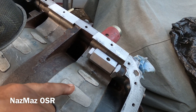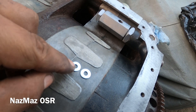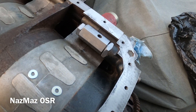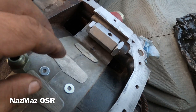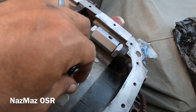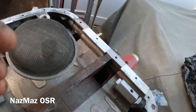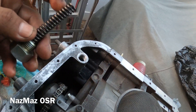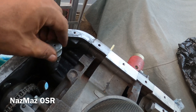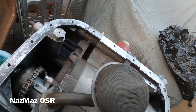I don't want to go more than 80 PSI. This is not really a race engine — just want something decent for the road. Basically what you do is get some shims like this — they're about an eighth to a sixteenth of an inch. You can get these at Pineapple Racing or your local hardware store. You drop two of them inside, and you've got to do that for both the front and the rear in order for there to be adequate oil pressure. Then you just drop the spring in there and torque it down. That's pretty much it. I'm going to torque this down and then put the oil pan on and call it a day.